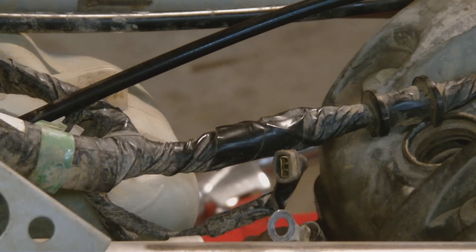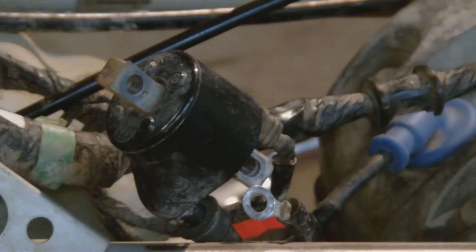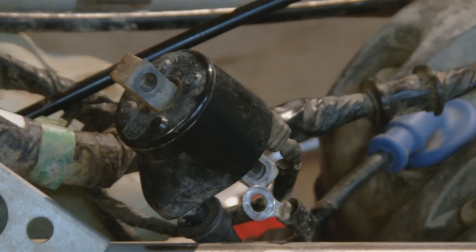I have a bad feeling it's going to be the stator - the pulse generator down there - which produces your spark on the bike. This is the quest for spark. The stator is not working properly - that's apparent. Not good news, but necessary news. I was really hoping for a positive reading. We're going to put all this back together and move on to the next test. My friend isn't here today with the other four-wheeler, so we'll have to test the kill switch another day and show you how to do that as well.